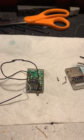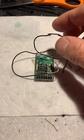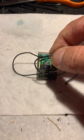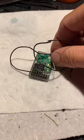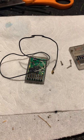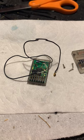If you've got a receiver distance issue, check your antenna first, because that's more than likely what's going on. You could have a bad receiver, but this was definitely an antenna issue. The previous owner must have got the wire caught inside the receiver box when he tightened it down — it crimped and tore the shielding on the outside, giving me only about 100 feet of range. So instead of throwing the receiver away, maybe try replacing the antenna. Just take it to a local hobby shop and see if they can match it up.